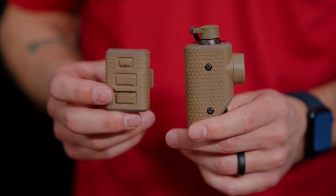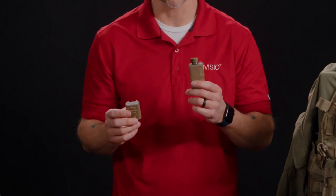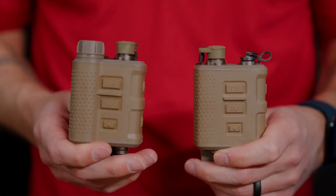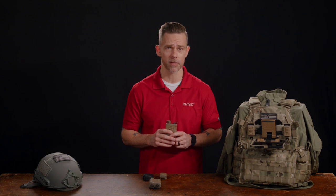There are a couple of ways you can set this up, depending on what V-Series Gen 2 control unit you're using. If you have a V10 Gen 2, you can pair up to seven of these to mimic PTT-1; PTT-2 on the R30 wouldn't do anything, but you could change your hear-through levels or turn off the situational awareness entirely with the mode button. With the V20 Gen 2, you can also pair up to seven R30s, getting all the functionality of both PTT-1 and 2, and the mode button on each. If you're utilizing a V50 or V60 Gen 2, it gets a little more interesting. You can pair several R30s to PTT-1 and 2, but you can also do what we call extended pairing — having one R30 mimic PTT-1 and 2, and another mimic PTT-3 and 4, giving you the full functionality of our most capable control units, all remotely.